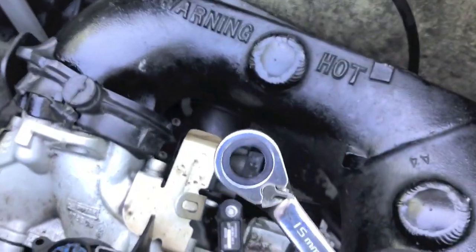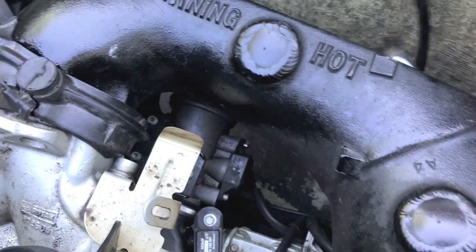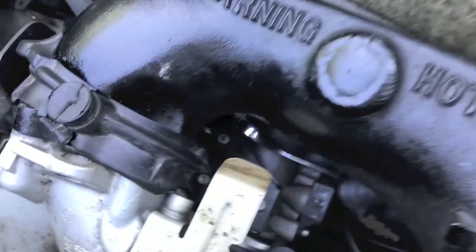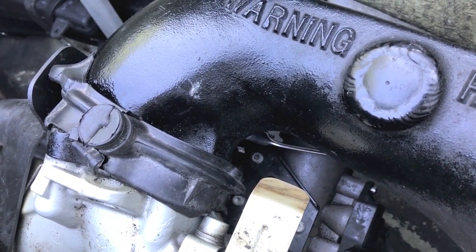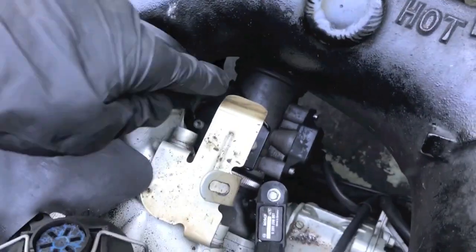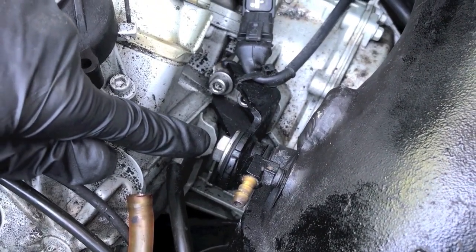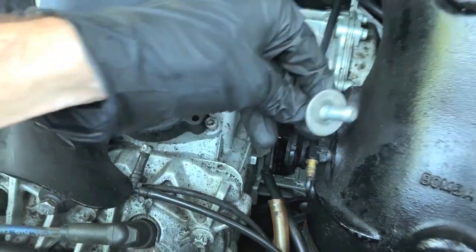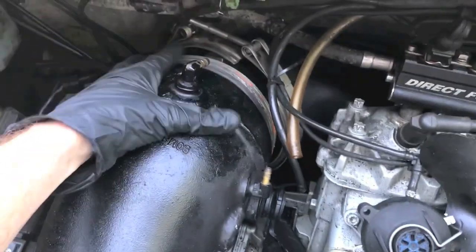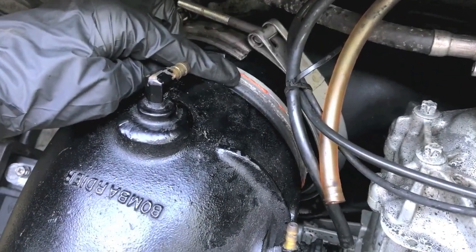On the opposite side, I've got a wrench with the ratchet portion built in — the 15-millimeter wrench. We are going to sink this wrench inside onto that bolt and we do not have to remove the nut, just loosen it up, and I'll show you why. At this point I have that 15-millimeter nut loosened — again you do not have to take it all the way off. The last bolt right here is an 18-millimeter bolt — go ahead and remove that. Back on the opposite side, the 18-millimeter bolt is also loose. The whole manifold is now loose except for where the actual gasket is holding it together.